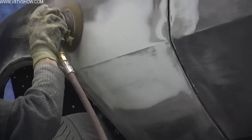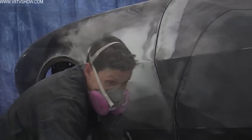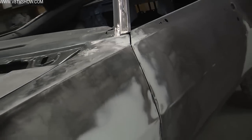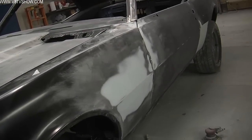Trenches that have to be filled again with another coat — but you can apply multiple coats, so don't worry about that especially if you sand it off. We find that we spread the whole car and sand it off many times, and when you start getting closer to your final desired shape you start using a finer and finer grit of sandpaper until you reach a grit that is acceptable to the primer you're going to use to cover it.